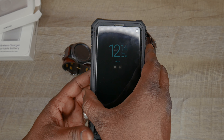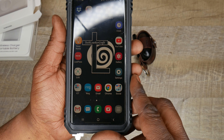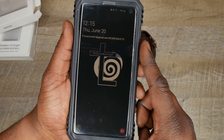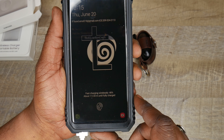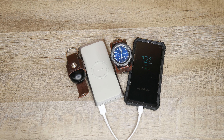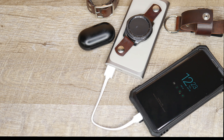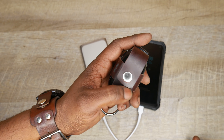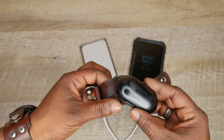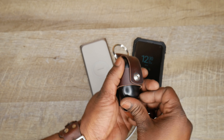What this adds is a little circular pad that says fast charging. It does support 7.5 watts wireless charging. The Samsung S10 is capable of taking 12 watts of wireless charging, so it is not maxing out the fast charge that your S10 is capable of. But for something like the Note 9, the 7.5 watts does trigger fast wireless charging, and on the S10 it also triggers fast wireless charging. It is Qi certified, so it should also technically work with charging the iPhone, charging your Apple Watch, and hypothetically should also charge your AirPods with a wireless charging case.